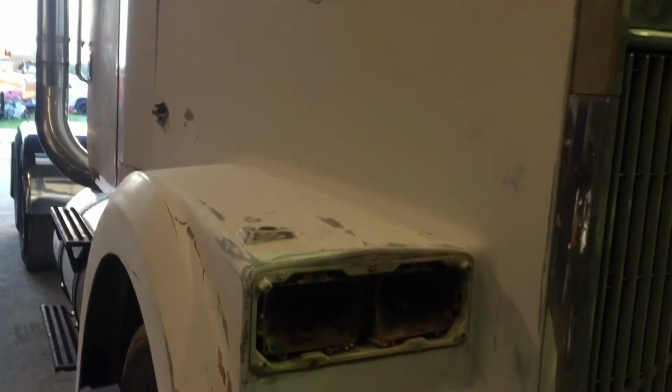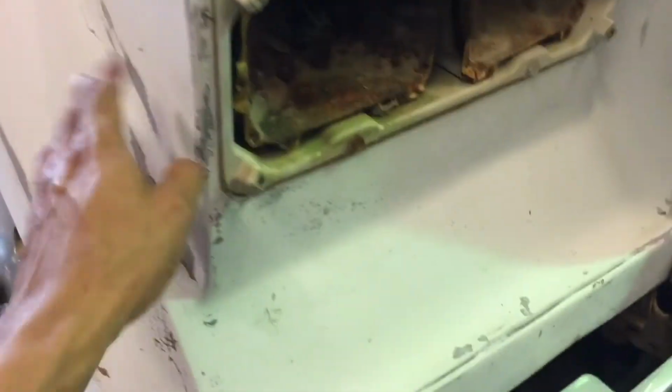All right, we are back after maybe 4 hours later. And you can see there's a little difference in this truck. The whole hood has been sanded down with the 60 grit. The body work still needs to be done on this side, just that front part and this little back part here, and just fill in these scratches as much as I can. The top of the hood is still the same. I just went over it a couple of times with the sander, which reminds me, I need to get a new sander because the one I was using just took a dump. I put that Bondo glass there, and over there on the other side, same thing on the corner area. Down here, same story.